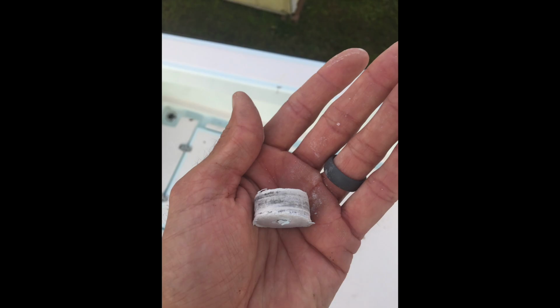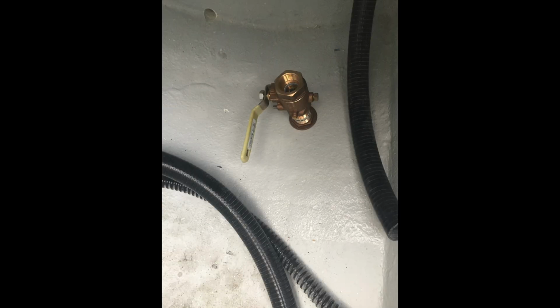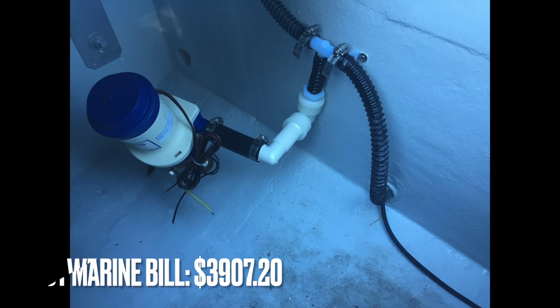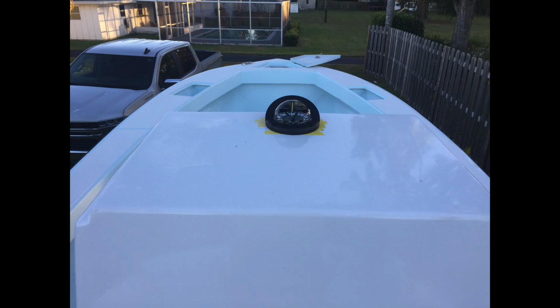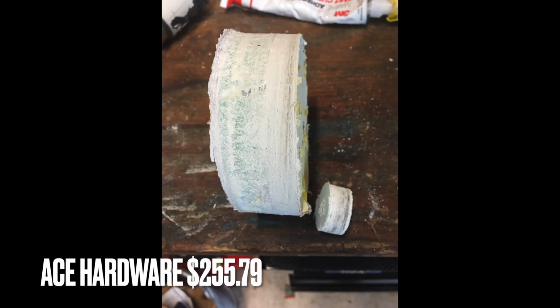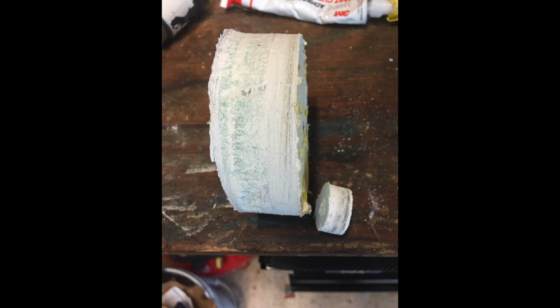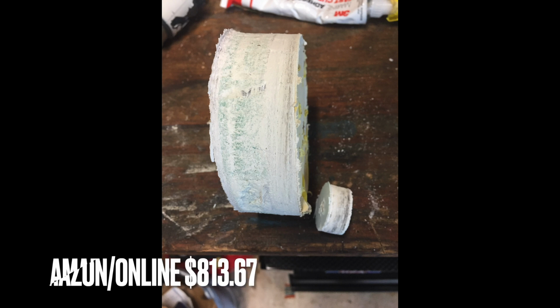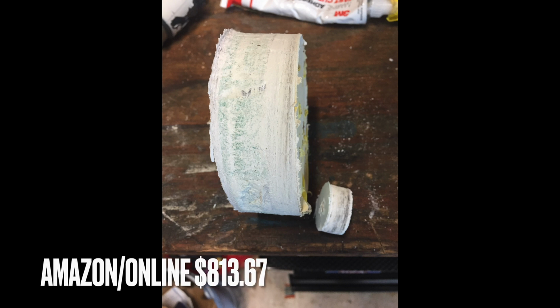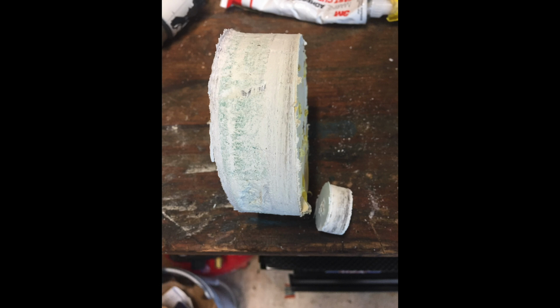Each weekday I'd get an hour or two to work on it before the sunset and everything got too dark. So I would just work as hard and as fast as I possibly could. And right here I'm throwing the compass on it. So you can see the chunk of fiberglass that came out of the hole saw here from the top of the console. But the thin one there from the hull of the boat, that's solid fiberglass. And the top one from where the compass came out, that's mostly foam.